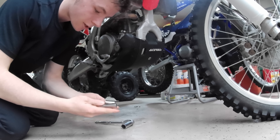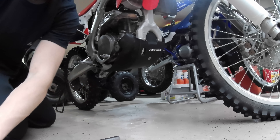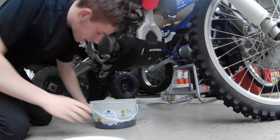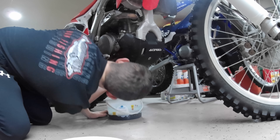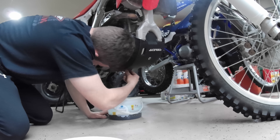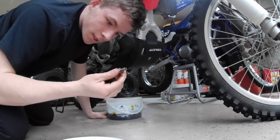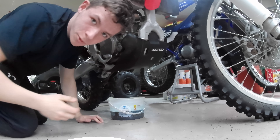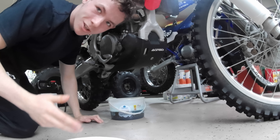Alright, I don't know what size it is, so I brought over half the toolbox. It's a 12 millimeter — a lot different than the Kawasaki. So with this one I have to replace a crush washer because this bike's been leaking oil all over my floor for the past month and a half. Also, no metal on the bolt, which is good. Now that it's dripping, we're going to put the bolt back in, but this time I'm going to put a crush washer because I realized there wasn't a washer on the drain.